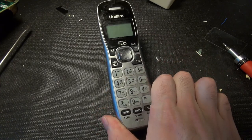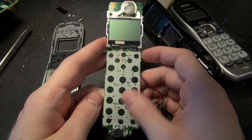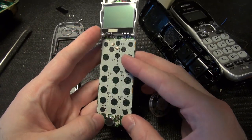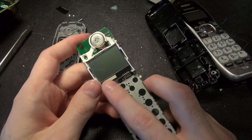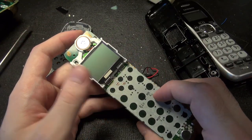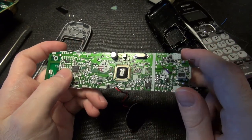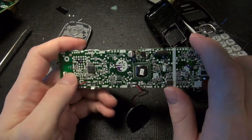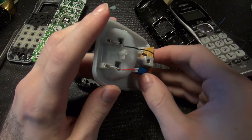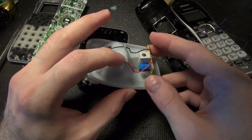Starting to speed up the process now. I have three of these handsets and I've taken one apart already. Main board with the buttons as expected. Four LEDs for the overlay part. Your microphone, speaker, ringer, and a little dot matrix LCD as far as I'm aware from the box — didn't power any of these on to check. On the back: your DSP chip, similar processor — this is actually version 2.06 — connector for battery, oscillator, inductor, and a little chip down here. Since there's three phones and one main base station, there are two floating ones. Inside those just has a single diode for half-wave rectification and a cap — that's it, because they all use those 8 volt AC plugs.